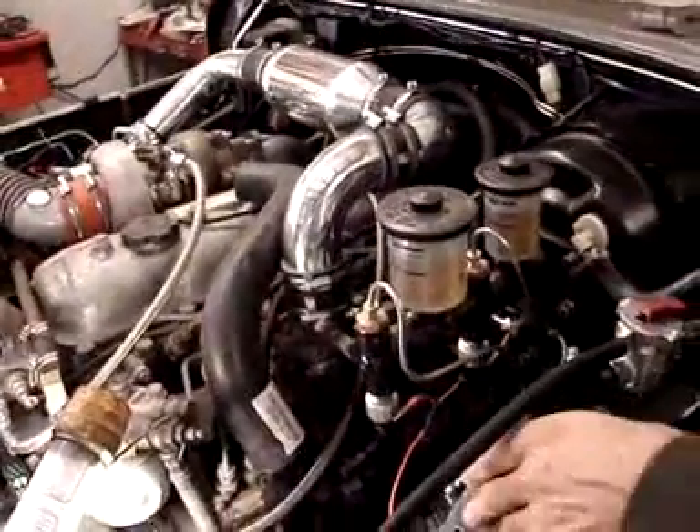Right now the fan is not going on, mainly because we're not at the temperature yet. This fan operates off boost, that fan operates off temperature. So when the boost comes up — when he's stepping into the pedal and the boost on the turbo comes in — it turns that fan on and cools this fluid down.